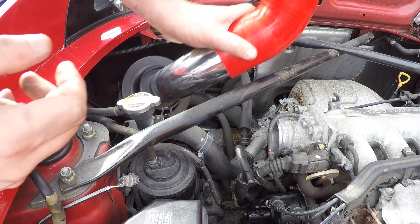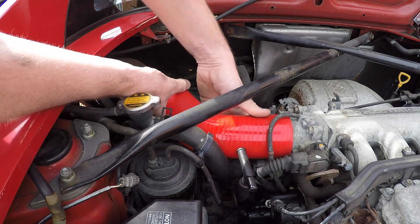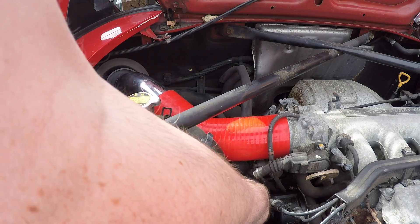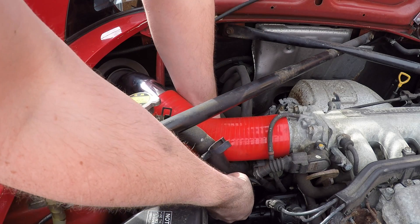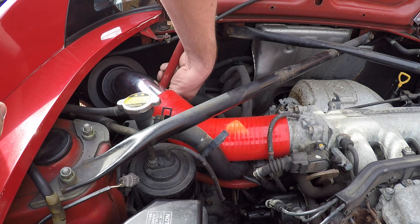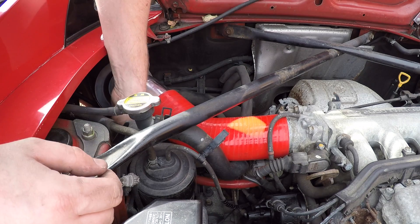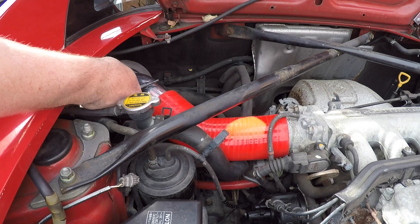Quick trial fit. And going to the filter like that, I'm going to throw this away and replace it with a stretcher hose here. This is the breather for the idle, so we're just going to have to chop this there and that will come underneath, inside the metal pipe, and then somewhere around our air temperature sensor that will go into the side in there.